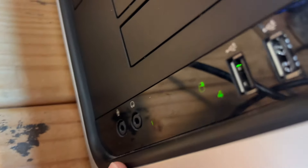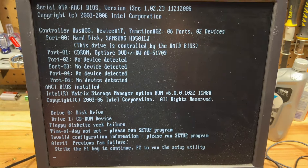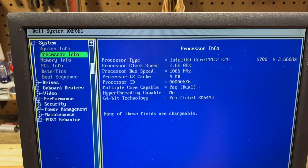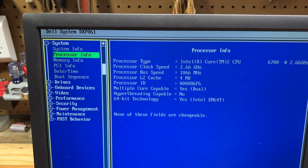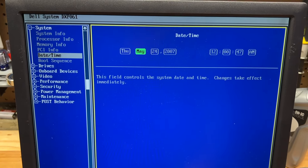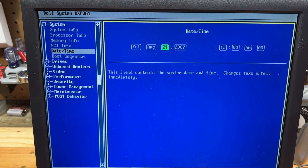Okay, we're doing something again. We have different lights — it's settled on two and three with the hard drive icon. Maybe we're doing something. There we go! Something with RAM — people keep commenting. So I just flipped the modules around. We have different lights now: two and three this time. Oh hey, there we go — that's a lot to read real quick. Let's hit F2 and go to setup. This keyboard's working. I guess we just had to move the modules around. Yep, a 2007 BIOS version. We have an Intel Core 2 Duo at 2.66 gigahertz — that's not too bad. Probably put Windows 10 on this just like everything else. Memory shows 2 and 1 because that's all we have at the moment.